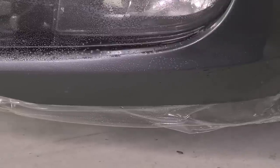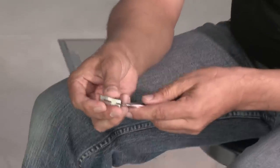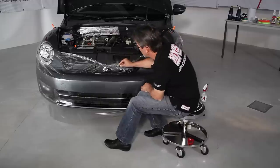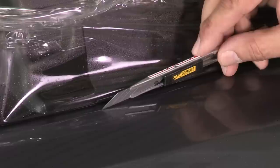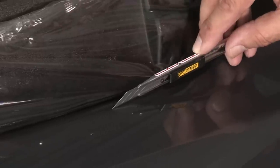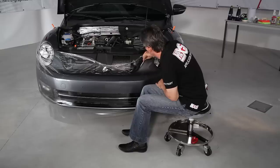The install is now finished and we're going to proceed with the cuts. It's important to refresh the blade. Always cut the product with a fresh blade, since we're going to cut the product directly on the vehicle body. It's very important to know exactly the pressure to incise the film and not cut so as not to scratch the vehicle body.